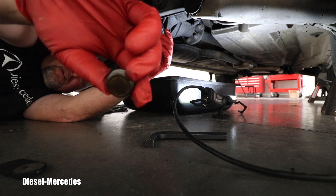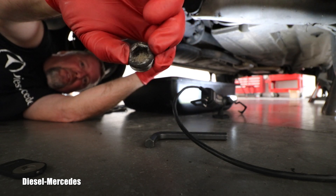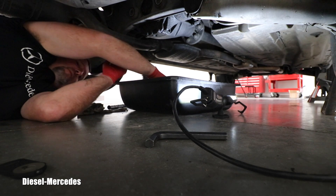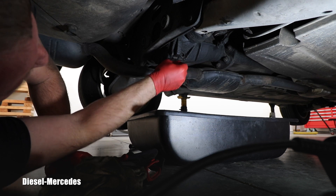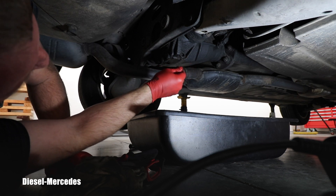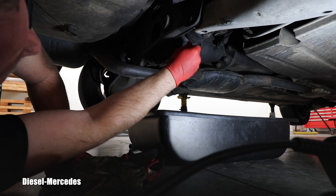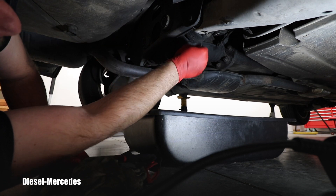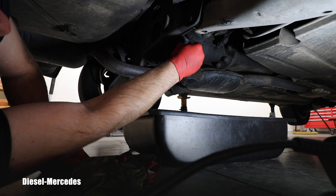I don't expect any flow from the filler, because you can see how much oil is on top of that differential — there definitely was a leak. If it's not overfilled it won't be overflowing. You can see the filler bolt here, and there is so much dirt and road debris around the drain plug that I don't remove it immediately. I started cleaning around it, and also cleaning inside the plug so the 14mm hex will fit nicely and I won't strip it.